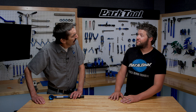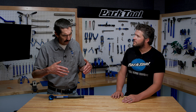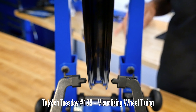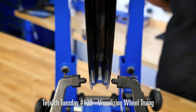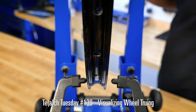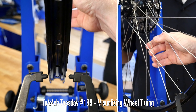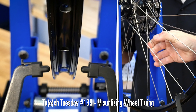Truman, it's been a lot of fun and that's been great, but are we getting all lost? Are we not educating? Are we not putting forward some points and some technical information? Sure we have, Calvin. Remember the time when we taught that person... We spin the wheel and look for our worst lateral deviation — the worst wobble. It seems to be right through here. Come to the opposite side and try these two spokes. Squeeze. It seems to make it better.